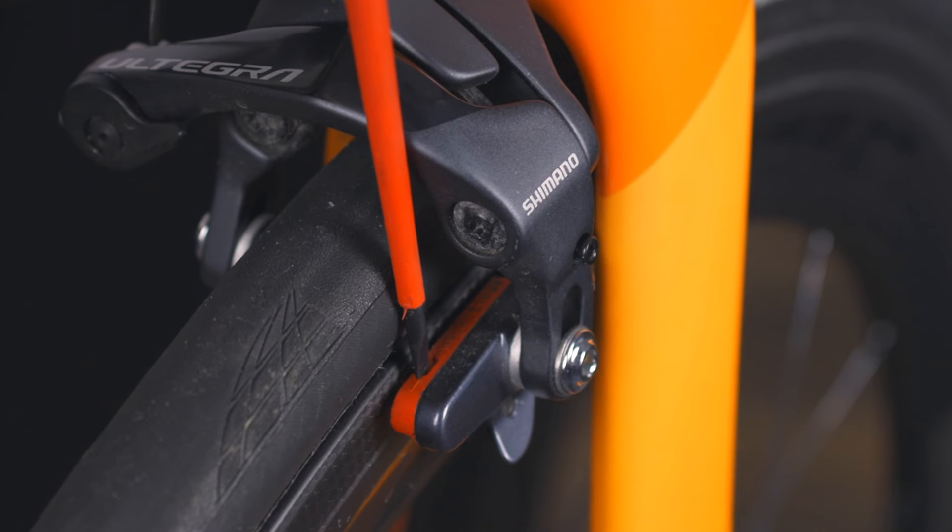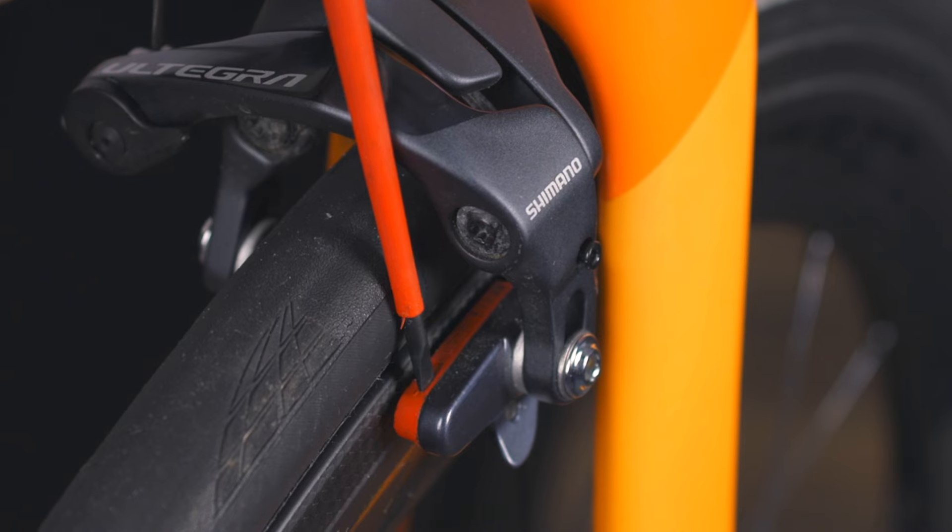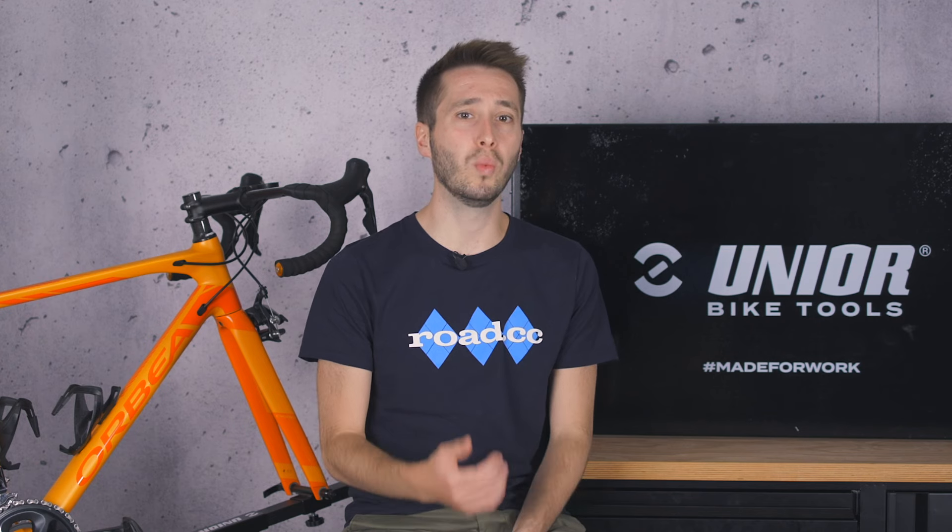Here we need to check that the pads have life left in them firstly, but also that they're free from debris and not glazed over. The wear on the pad can be seen via a wear indication line. You might have to clean the pad to view this line because brake dust gets everywhere. Just a wet white rag should do the trick. Once you've located the line, ensure that there is plenty of pad left. If you're getting close — down to about 2mm left before the wear mark — it's time to buy new pads ready to replace them.